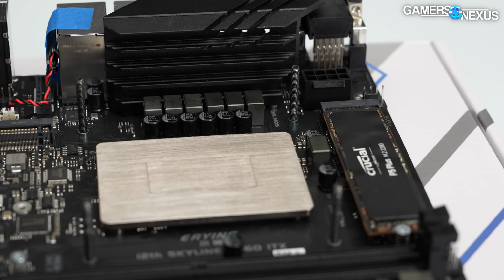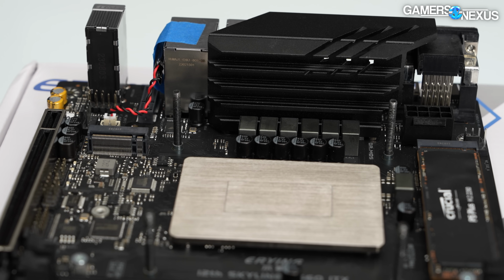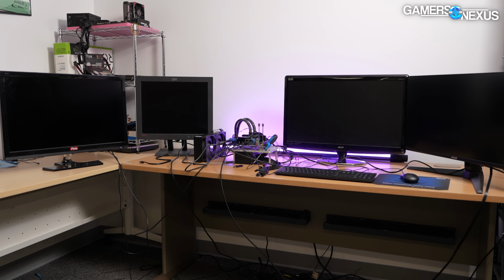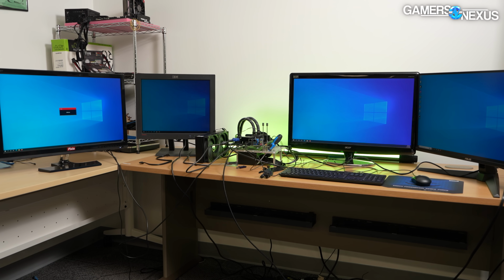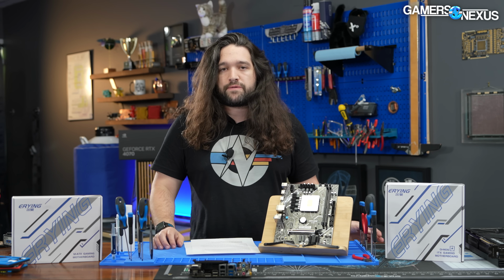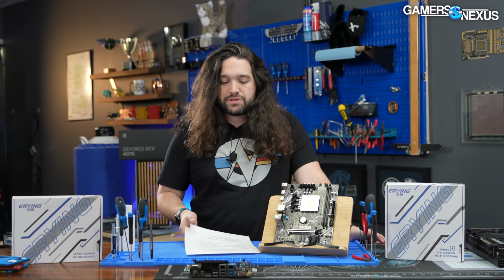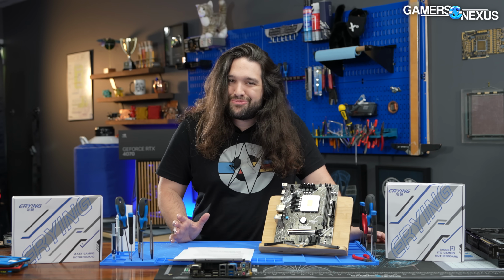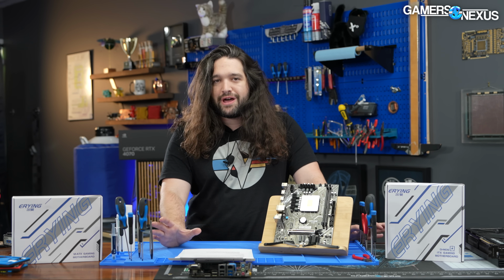So the Mini-ITX one that we have, being about $320 for the 12700H and a board with all the I/O that you have, which actually is a ton: 4 display outs that all work simultaneously, 2 Ethernet ports, 3 M.2, a lot of USB. It's really compact, a good set of hardware for pretty cheap. But the $135 options, especially with those engineering chips, start to look like good value. It's just that now you're playing with engineering chips, and sometimes they have really weird quirks that the manufacturers may not be aware of, because those are not legitimately sourced.